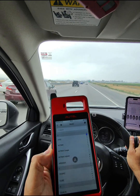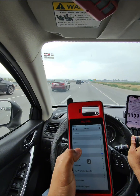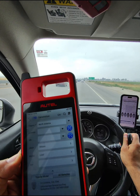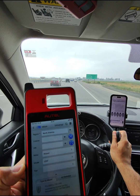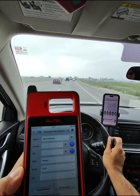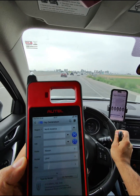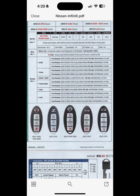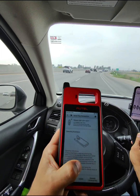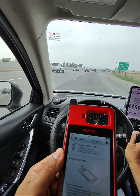Then it's going to be a Leaf. I know it's 808 right here because I have a PDF chart that tells me exactly what kind of key it's going to be with the FCC ID number and the vehicle information — I'll put a picture of that on screen now. We're going to go ahead and choose the 808, so the last FCC ID number is 808.